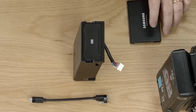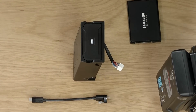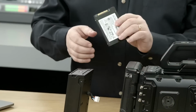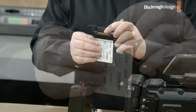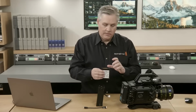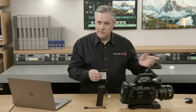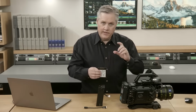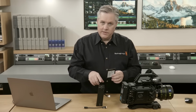It supports the same SSDs that the previous model did, so you can put an SSD in there. But it also supports these new NVMe based 7.5mm 2.5 inch U.2 drives, which is one here. They look similar to SSDs, but if you look across there are actually some extra pins. You can also use the M.2 drives with an adapter. The M.2 ones are the ones inside computers, those little boards that plug onto the motherboard. They're very, very fast, and you can get an adapter for those and put that in as well. So this will do both SSDs and these new faster drives, the two different types of drives in the same unit. The other model didn't do that, it just did SSDs.